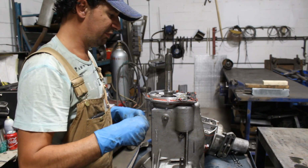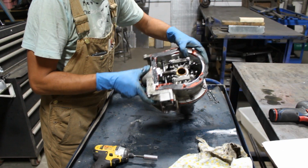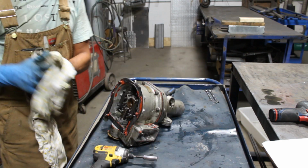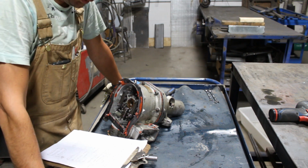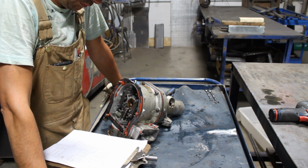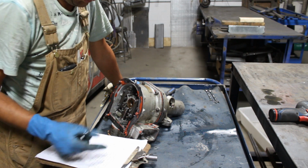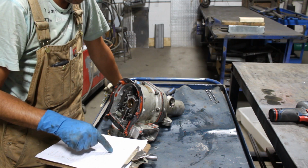Okay, so I recovered all 8 springs. On these 8 rods is where all the 8 springs go. Let me see what the manual, or the guide, says. First we have to remove the cover, drain the oil, remove the solenoid, and split the overdrive from the transmission. All this is done. Oh, and it says here, nuts from short studs first and then the long ones. Well, I took note of that. Anyway, next is the operating valve.